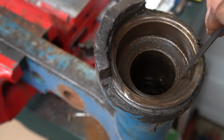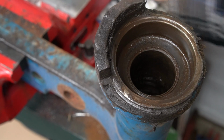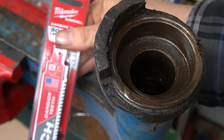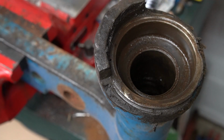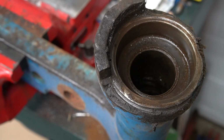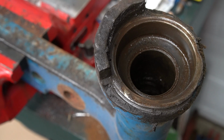So I already took the other side out, and I ended up having to use a Sawzall with a carbide blade to cut it, and basically put a slit in it so I could collapse it. If you go buy a Sawzall blade, I highly recommend these torch blades from Milwaukee. Not sponsored by them or anything, it's just that these are a carbide tipped blade, and these things are great. They cut like a torch. My blade, I actually took and modified it, cut it down for another job. There's your product idea, Milwaukee, if you watch this video.